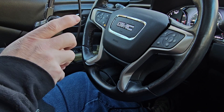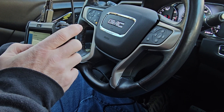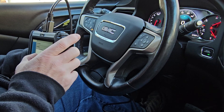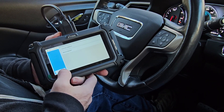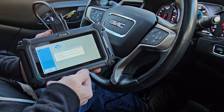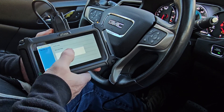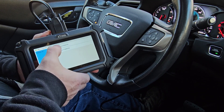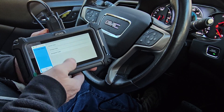I'm not going to show you the VIN, but it has your VIN and it's showing a GMC Acadia 2018. So we're going to go back — it was communicating, so now it knows what vehicle we have. We're going to go back into OBD2, hit auto scan again, first module, read trouble codes, stored codes.